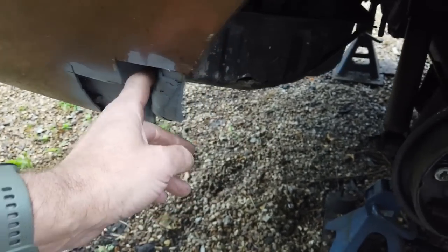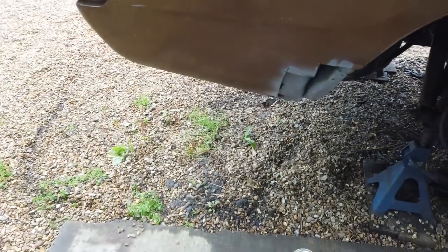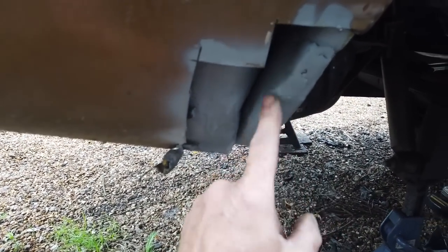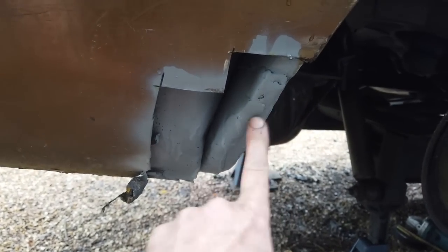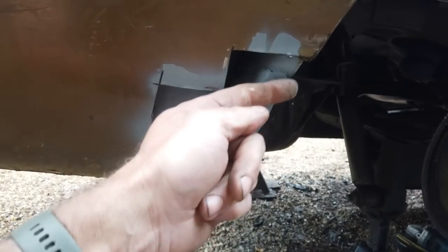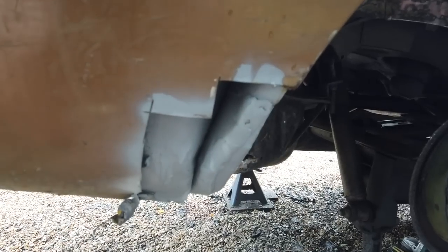That's where we've formed that scallop shape. You don't see it on this side. It's neat on the inside. It's a bit ugly where those spot weld folds go, but that's how I made that scallop panel. Remember, it was like a claw type cut, like a clamshell type cut, and then crimped into the existing metal to get the shape, and then bent over and spot welded, then seam welded between. To get it looking really good, you'd skim that over, but the panel comes in there, and then it's going to be caked in wax oil.